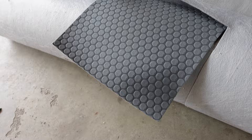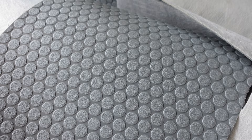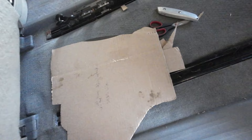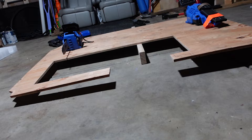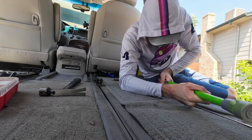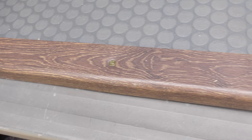For floor material I used RV coin style flooring — it's extremely durable and has good grip for dogs so they don't slide around. Beware though, it does expand with heat so be thorough when gluing it down. I recommend making a template piece that matches up when flipped to either side for easy measurements. It's hard to get perfectly flat plywood so I took extra measures to try to get the warp out — it didn't work. Also, if you have a Toyota Sienna, you know about the center trolleys that are nearly impossible to remove, so I wasted hours on it, stripped the bolt, and ended up just building the box over it. I used a plastic-y material to trim the edge of the floor with high contrast so you can see it.